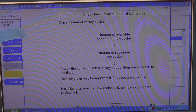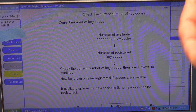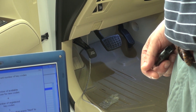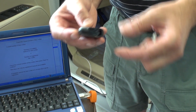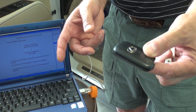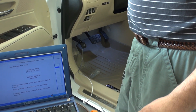There is some other info I want to explain. Inside the fob there is a physical key. The only usage for this key is opening the door or locking your glove box. You can also split the fob apart to look at the battery and change it if needed. In case the battery is dead and you want to start the vehicle, you don't need to change the battery — just put the fob logo right by the start button and you can start your vehicle.